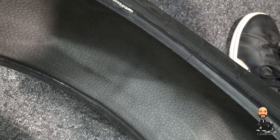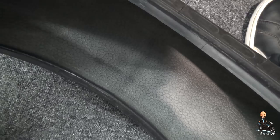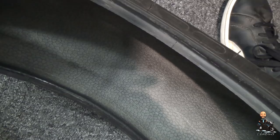So you need to check inside your tyre. I'm going to check it all, go around all of it, just to make sure that there's no extra damage and no gunk in there. This tyre's clean inside, but it's quite possible that if there's been some damage and the tyre's gone flat and you've ridden the bike with a tyre that's a bit flat, it could have done some damage inside to the rubber. So you're just checking, making sure that there's no rubbish in there, no cords gone, no bigger damage than you expect. And it's also important to compare it to other repairs - so if this tyre's been repaired before, there are rules about where you can put other repairs, because if you've got repairs that overlap or so many within a certain portion of the tyre, then it becomes not repairable. But as I say, this one is clean.